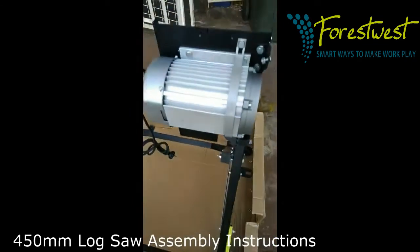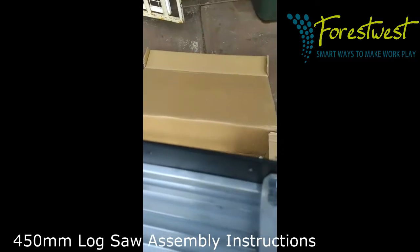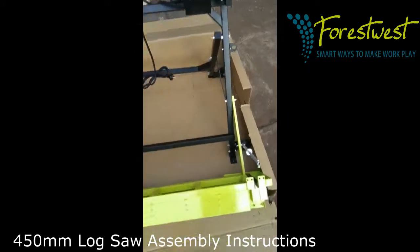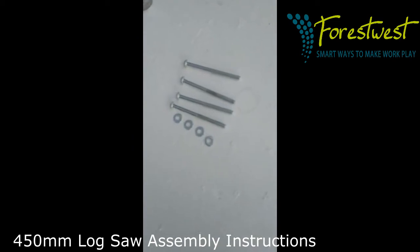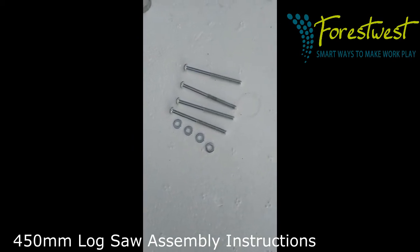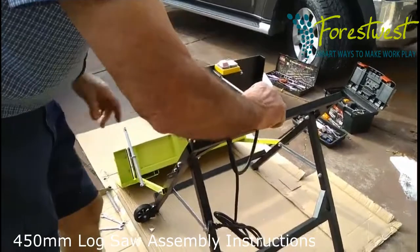We're then ready to put on the switch. The switch mechanism mounts to the back of the motor plate through these two holes here, and that is done using the long bolts with the appropriate washers. Just position that — the actual thread back of the motor is threaded. Once we have put the switch in position and it's nice and firm, it's then time to put the spring into the glide tube.